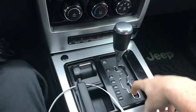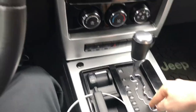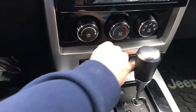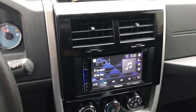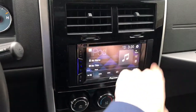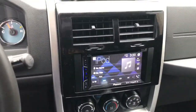Make sure your gear shifter is in second or first gear. There are two clips down here — I broke the one on this side — and you're just going to carefully pop it out this way. Once that's out, it's pretty straightforward: there are four bolts holding in the head unit. That's all the trim pieces I took off.